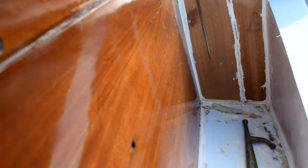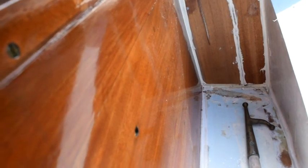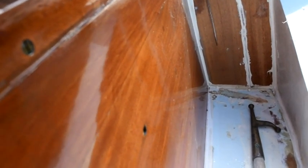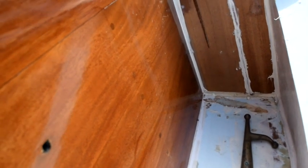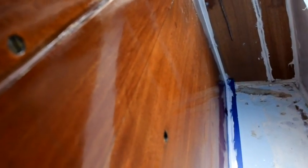So that's where we are in terms of filling out the last few leaks. This is however a difficult area to work because clearly I can't stand beside the boat — it's kind of a pain to turn the boat around for a five-minute caulk job. So I'll just have to climb out on the side deck and work out there, maybe with a safety line going up onto the cabin top to a handrail, and try to get that sealed up. The caulk down there at the base of the cabin house is cracked and that's where we're getting some leaking. I've taped it and put tabs on the tape so it'll be easy to pull off. Then crawl out there and put in a line of caulk — that should seal up the gaps. In just a couple minutes I'll pull that tape before the caulk starts to set up so that it won't tend to pull the caulk off.